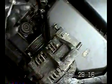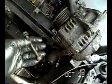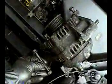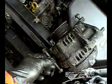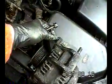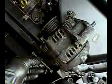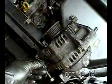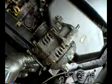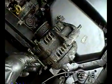All right. But what I want to explain is there's two bolts here on the side of the alternator that hold it on. This little short guy goes on the top, and it just screws in. This bottom one was a little tricky because you don't really notice it at first, but it's actually a bolt with a nut on the end. All of these are 15 millimeter bolts. There's three that hold it on. This bigger guy down here, I had to access from the bottom of the car. It's the only way I could get onto it. This one here I could get from the top of the car, reaching down. This is from the bottom reaching up. You've got to go in from under the fender to reach it. It was kind of hard for me because I forgot how to do it, but maybe it'll be easier for you now that I'm explaining it. So these three bolts hold this thing on.